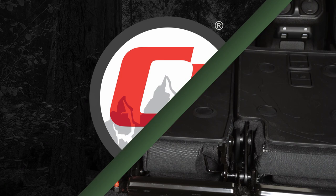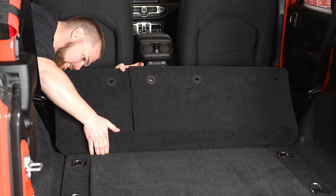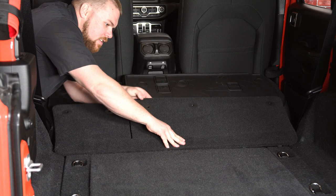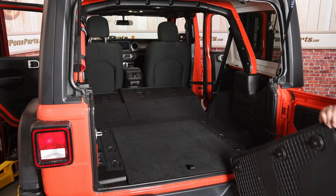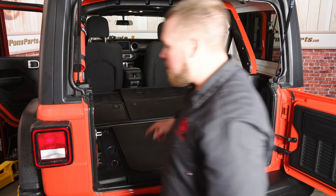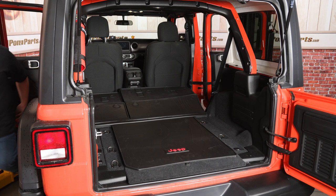Once you have all five of those clips in, this small section has slots that go onto the t-clips underneath. Just align them and work your way across — you can hear them actually click in. Make sure all of them are pushed in the right way. Then grab the last piece, the rear cargo liner, and walk it right up so it sits in place. Clip those into the inserts we just installed, go around to the other side, clip that last one in, and that's good to go. This install is complete.